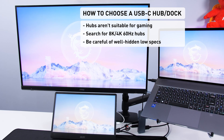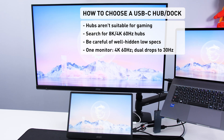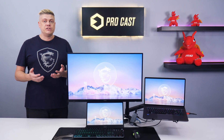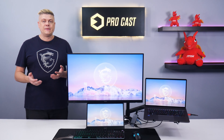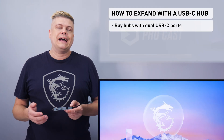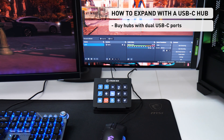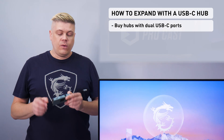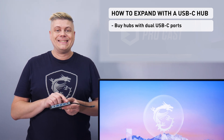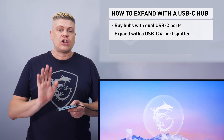Sub-$100 dual HDMI and DisplayPort hubs may seem amazing, but with only one monitor connected you may get 4K 60Hz — plugging in a second will drop this to 30Hz. Few hubs have USB 3 Gen 2 speeds of 10Gbps, but many have Gen 1 speeds of 5Gbps. Dual USB-C hub ports are crucial, as you'll be occupying one from your laptop, and many expansion devices such as audio interfaces and stream decks use USB-C. One port is always for plugging in a 60 to 100W charger, so you'll need two for one usable USB-C data port. You could expand ports with a USB-C to 4-port splitter, but video pass-through stops at the first hub.